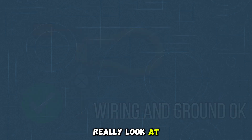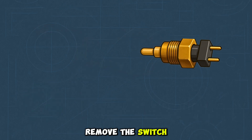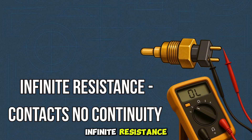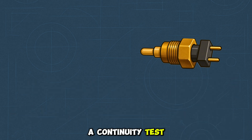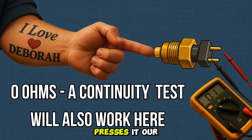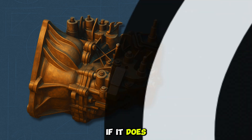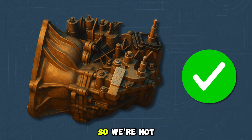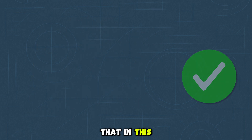We can't really look at the gearbox, but what we can do is remove the switch, unscrew it, and when it's not pressed you should have infinite resistance - no beep on a continuity test. But when our mechanic presses it, you should have a beep or 0.1 to 0.2 ohms - something like that. It must change states. If it doesn't, you've got a knackered switch. If it does and you've got good wiring, you might have a knackered gearbox - very unlikely though, so we're not even going to discuss that in this scenario.